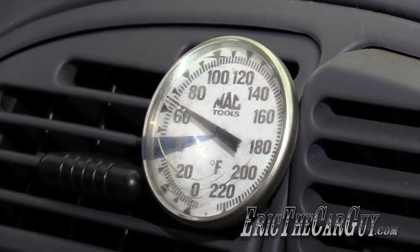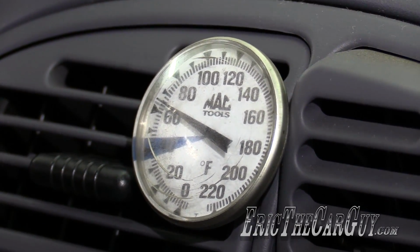It was actually colder when we first got in, before we started checking the temperature, before I raised the idle. Like at idle, it seems fine. Maybe because I'm raising the idle, it's telling the computer to do something different with the cooling fans. And those cooling fans may not come on while you're driving down the road at that RPM. So maybe that's what we'll do. We'll disconnect the system, we'll go driving down the road as if we're operating the van normally and see what the vent temperatures are then.